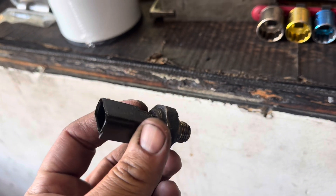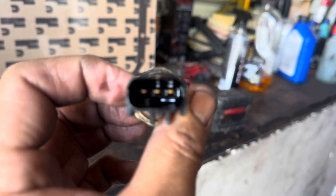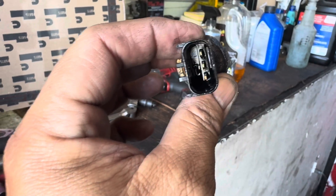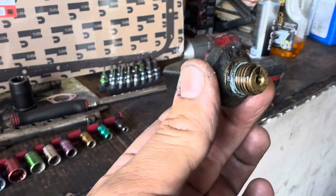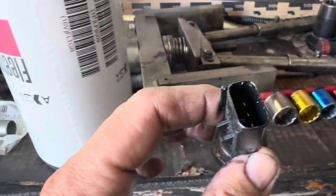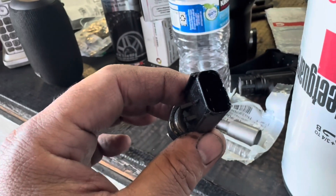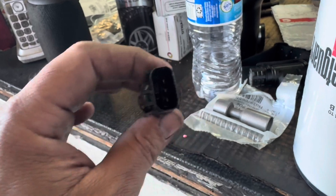Here is the actual oil pressure sensor that we took off of the truck. You're going to look inside — as I've mentioned before in some of my videos, we do have some oil present. It's kind of pooled and collected. So I replaced that oil pressure sensor. Still not terrible, but it's not great. Fired up on a cold engine, less than 50 PSI, and then it drops down — you can see it dropping pretty quick.